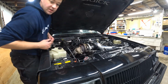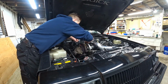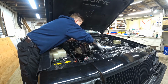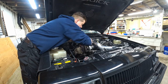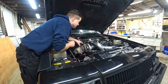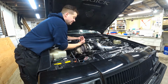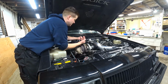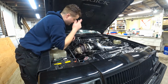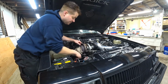Now, how do I keep my orientation? I'm going to make a mark. And when I pull this tube out where that mark is, I want to bend it just 5 degrees this way. Make that thing a little straight, so it's, as you can see, it's coming out at this angle. I'll go ahead and put a little 5-degree bend in to straighten that out, and then I'll make the final 90-degree turn to go to the fitting.